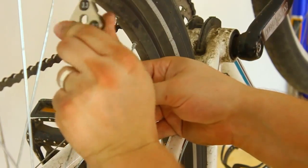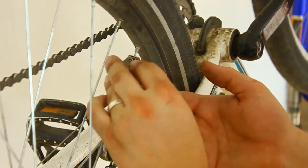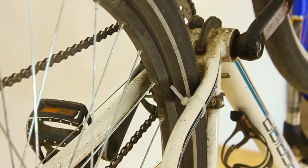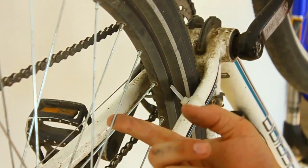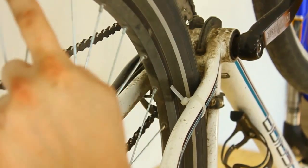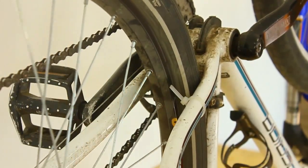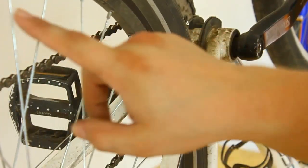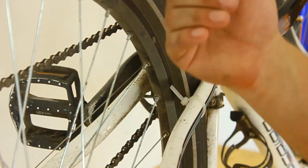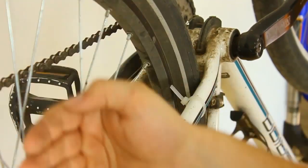I remember that I had six spokes total, so this one as well — one half turn. From here to here, all these spokes one half turn. If we do the whole circle and come back, you can hear it was chafing the whole way after truing it. The rim was actually pulled in my direction because we tightened spokes on this side.